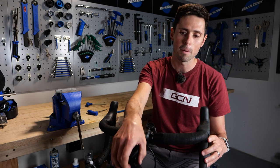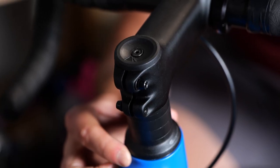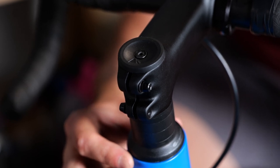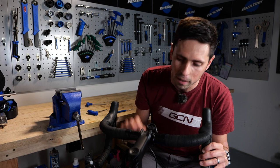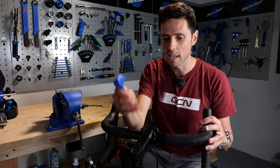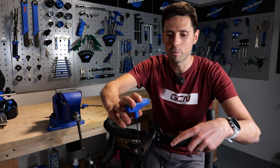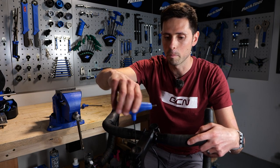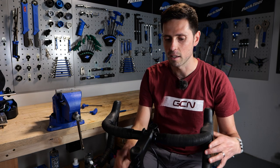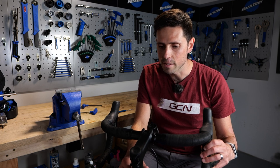With your bike on level ground and the stem bolts loose, you can apply your front brake and then just gradually and gently rock the bike back and forth whilst feeling the upper and lower headset bearing. You can also listen and hear that little bit of knocking. If that's the case, that's indicating that there's some free play in there. You can take your hex wrench — in the case of this bike, three mil — and then apply a little bit of preload through the whole system using the top cap and the bolt. You don't have to overly tighten this; you want to do it incrementally and then apply that front brake and rock the bike back and forth until you've just removed any play in the system itself.